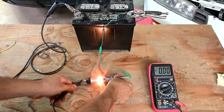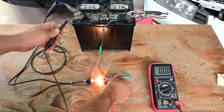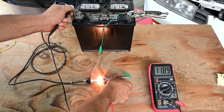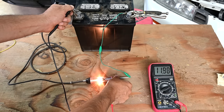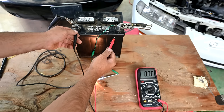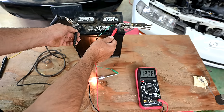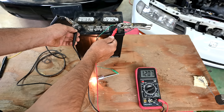Since this is a test lead and I can't put it right after the light bulb, I'm going to put it up here at this connector where it meets our car battery. As you can see, we have about 12.03 volts, which is basically what we have available on this battery — it's a little undercharged. Again, as you can see, it reads 12.06, 12.07 volts.